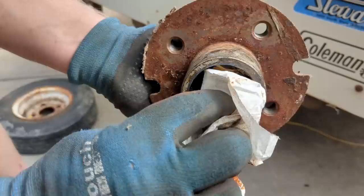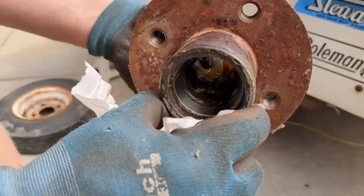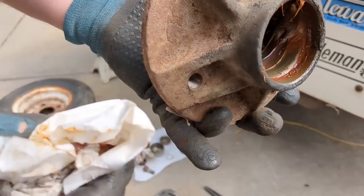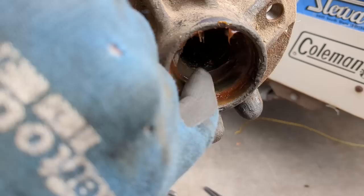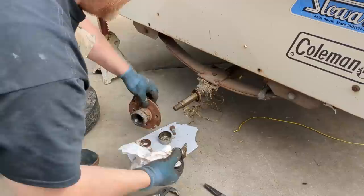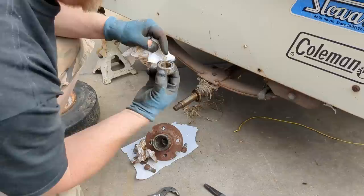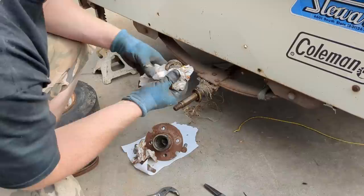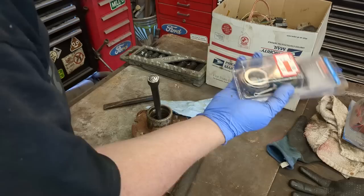How do you tell? The outer bearing looks just fine — it didn't have any water on it. Look at the race. If the race has any marks on it, lines from where those bearings are sitting, you need to replace it. That looks pristine — this outer bearing is excellent. The inner bearing — wipe that away. You can see the discoloration on the race and lines where the bearing was just sitting. That bearing is going to fail. Even if I didn't have pitting, that bearing would fail. So on this one, the outer bearing — the race looks beautiful, the bearing looks beautiful, it's a Timken. I'm going to reuse this one because I guarantee this bearing is better than the cheap Amazon $5 bearing I can buy. I'm going to rerun this outer bearing, but I'm going to replace the inner bearing and race.